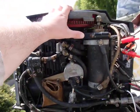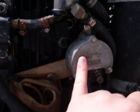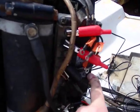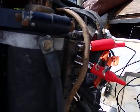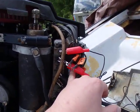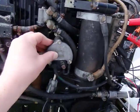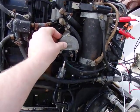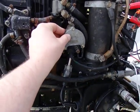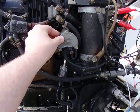If you're looking for specs on this engine in particular, I got a lot of great stuff from BoatInfo.net — I'm going to include a link in the description. So we don't have any spark coming from here, which means we have to start digging into the CDI ignition. This here is the CDI ignition module. A CDI ignition works very similarly to an HEI style ignition, except it uses a high-capacity discharge with capacitors inside the unit. These capacitors charge up and discharge every cycle. At lower RPMs you'll actually receive three sparks per rotation, but at higher RPMs you'll receive one full spark.